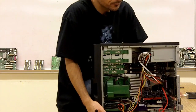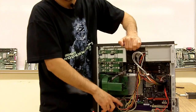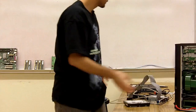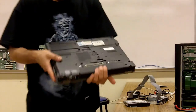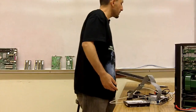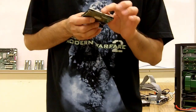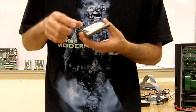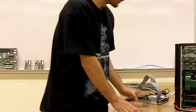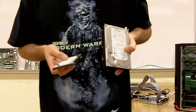The first thing you need to do is take out the hard drive from your computer. Sometimes it is very simple — you just pull it out and it comes out easily. Or if you have a laptop, you just have to flip it over and unscrew the correct compartment so it will come out. This is what a laptop hard drive looks like. This is an older IDE laptop hard drive — as you can see by these pins, it's IDE. The SATA is the same dimensions, just a smaller version of the SATA connector.